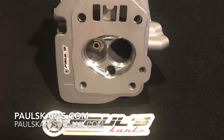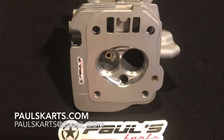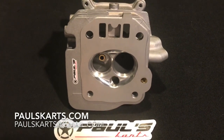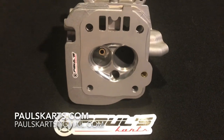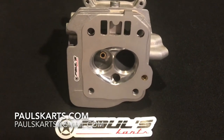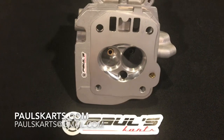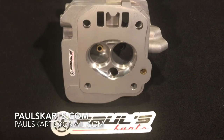This is pretty much all the CFM you can get through the stock casting. Even for the 266cc bore - the 3-inch stroker billet special alloy stroker with the 3-inch sleeve installed in the Tillotson block - at 9000 RPM you only really need about 90 CFM. But you'd also have to calculate for over 100% volumetric efficiency, so you're probably looking at anywhere from 95 to 110 CFM requirements on that application.